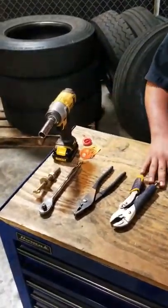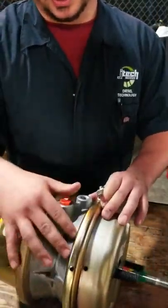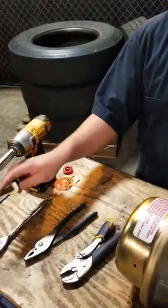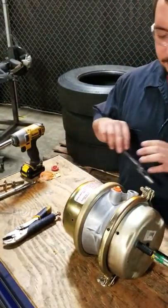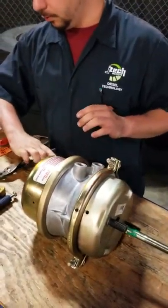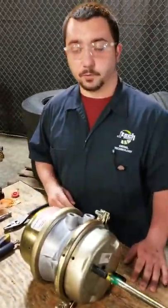These are the tools we're going to be using to tear apart this side of the brake chamber. This side does not get taken apart — it is sealed off. If you'll notice, it has a bolt on both sides with a clamp that goes around. This is the side that we're going to service. This side will be caged with our special caging tool. We've got our vise grips, which are going to be used to lock down the rod — I'll show you that in a minute for reassembly. These pliers we're going to be using to take these plugs out so we can supply air into the hole to activate the plunger inside. You can use a ratchet if you want, or I'm going to be using a drill — just whichever works for you and your application.